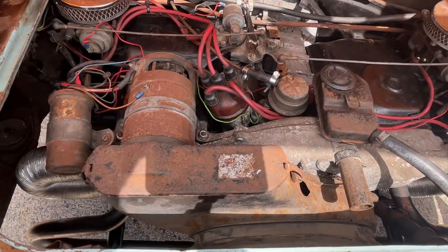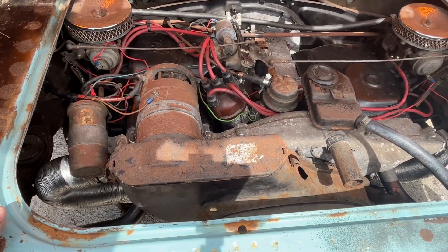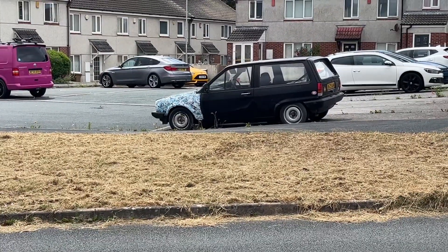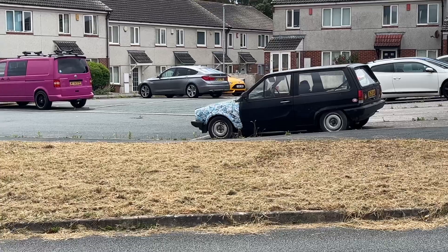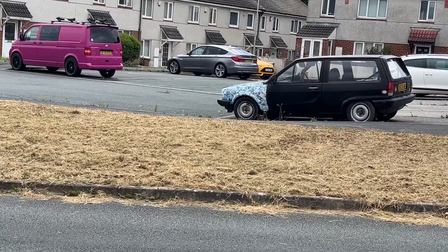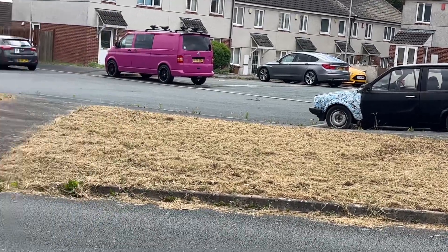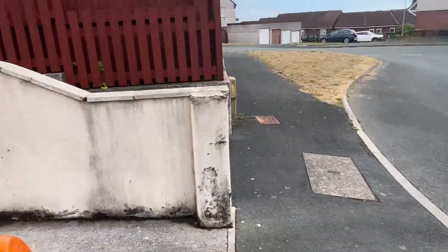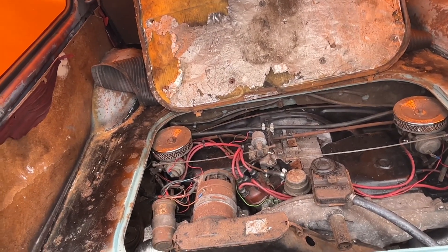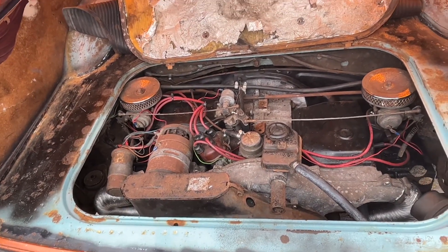Running lovely, idling lovely. I'm going to get some leads and a dizzy cap. Massive thanks to Tim. While he was here, he said he'd take a look at my bread van, because since I bought it he's been running terrible, even though I put that metal flange on. Took the carb off and it was just filthy — a load of rubbish in it. So we took it with him, he's going to rebuild it and also make a Bakelite gasket in between the metal and the carb itself, because of the heat.